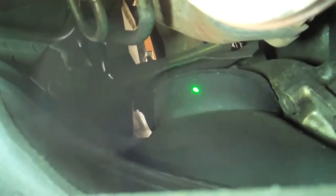We have the car up on the rack — you brought it in because the engine was running rough. I'm under the car right now on the driver's side and I want to point out that this motor mount right here is collapsed and it's touching the engine bracket. When it's this low, it'll cause the engine to vibrate and resonate through the chassis of the car. We're going to suggest that you change both the left and the right side motor mounts — that's why the car feels like it's running rough.